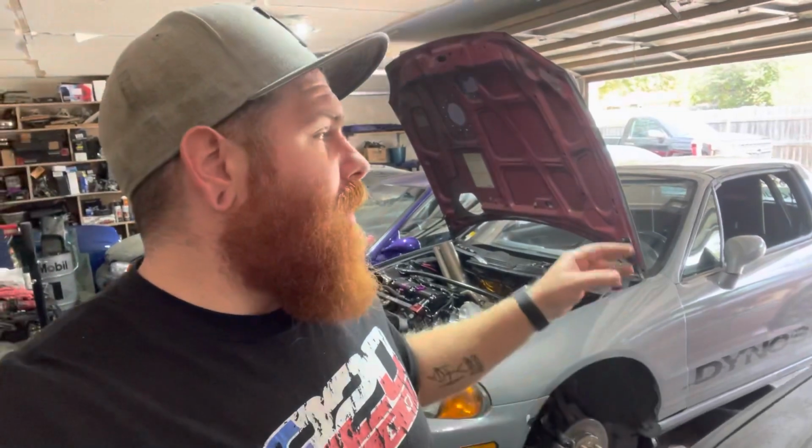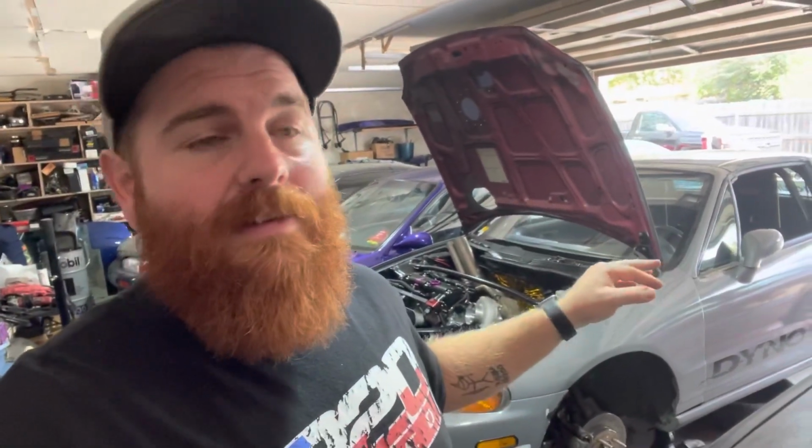I did notice that my fuel pumps are screaming, which usually means that I let the car sit too long, and I'm sure the filters are clogged. The E85 that's been sitting in this thing for months has probably gone bad. So I'm gonna end up draining all that, then clean the filters out and do the throttle cable. Probably steal the wheels back off of this thing, or throw something on it, and then go test drive it, see what it does.